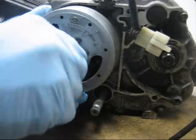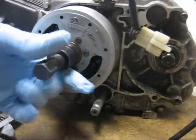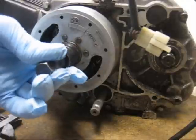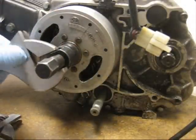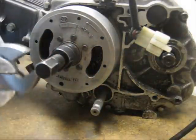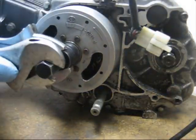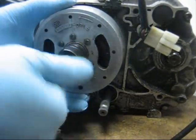The flywheel's been on here for years. I just screw it in — it's a left-hand thread — until it stops, then I screw in the middle part, which is a right-hand thread, until it stops. Get a couple of adjustable wrenches, and this will save your life. Done. The flywheel's off.